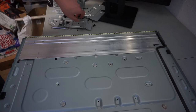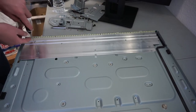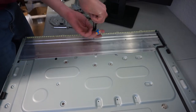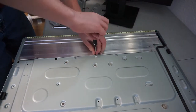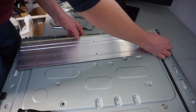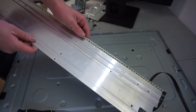Let's take a closer look. Here is the backlight — we just have a strip of LEDs running along the edge of this TV up against this metal heat sink. Looks like we can remove it just by taking out all these little screws. They're in there pretty good. There's a little cable over here to be careful with. And there we go — here's the backlight. I'm going to go ahead and remove this completely and set it aside.